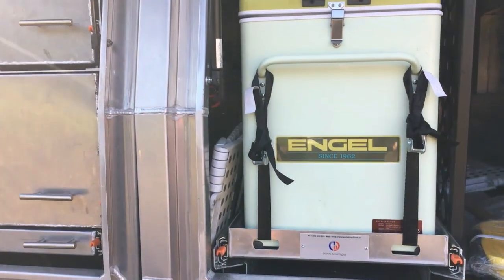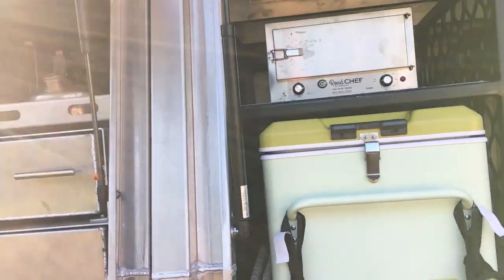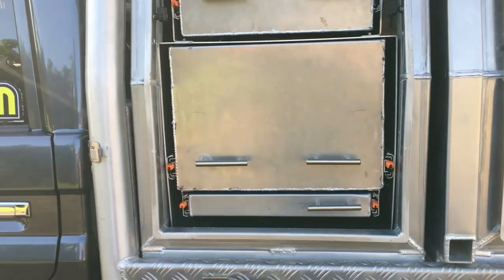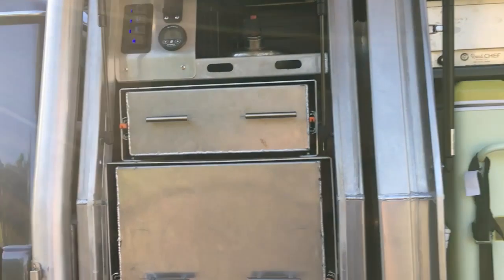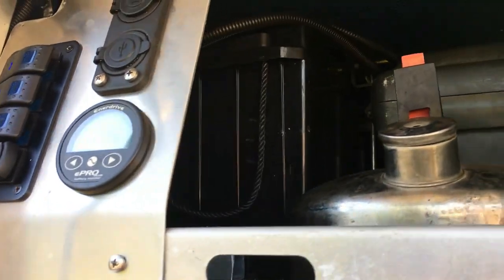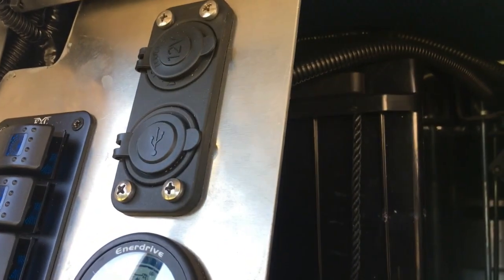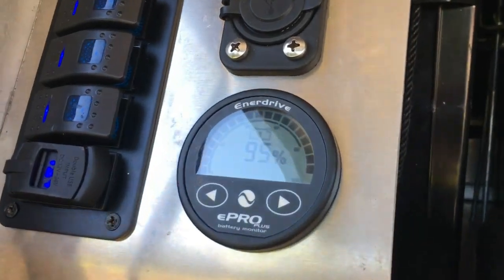So this setup is much lighter and gives me 50% more battery capacity. You can see there I've got the 40 litre fridge there which runs permanently and the travel buddy oven, lights and stuff under the door. This box here is only 580 mil wide. The front box and rear are two separate boxes on this 79 series. That 200 amp lithium lives up the back in behind — a bit hard to see in there but it's sitting on a shelf, mounted in behind these gauges and lights and stuff. Space was critical to me and I've got as much battery power as I can.